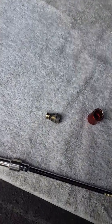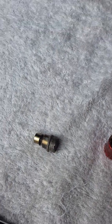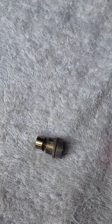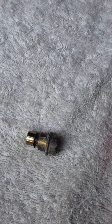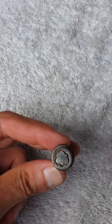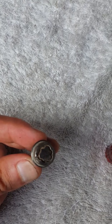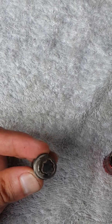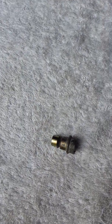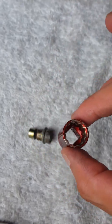All right, everybody, this is for the F150 spare tire key removal without the key and also without a bolt strip tool, extrication tool. What you have is the pin at the end, okay? You need that special tool. Now, everybody is saying that you need a 15 millimeter bolt extraction socket. What I found works perfectly is just a standard 14 millimeter socket.